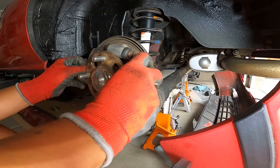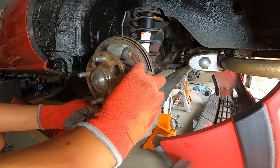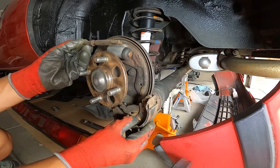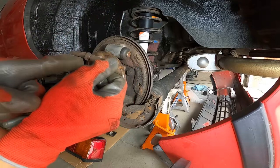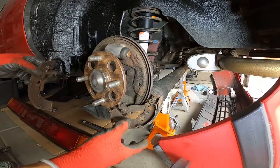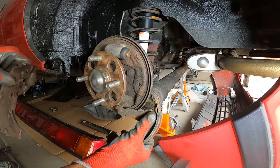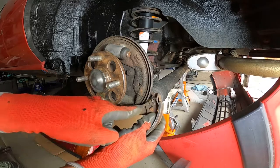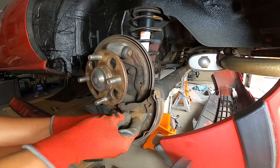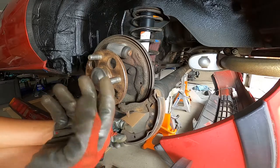Next, we're going to free the brake shoes — one slides out this way, the other slides out down here, and you just unhook it from the spring. Right here you have the self-adjuster, which has a ratchet that adapts the brake pad as it wears down so it always maintains tension. Remember: the keyway goes on one side and the longer end on the other. The forward brake shoe comes out one side and the rear shoe out the other. There's a parking brake arm on the rear shoe held on by a little horseshoe clip — pop that off, remember which side the arm attaches to, and slide the pad off.